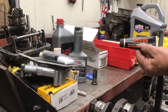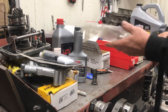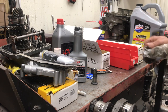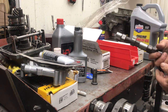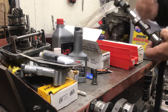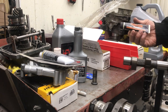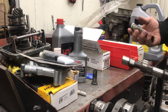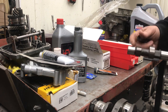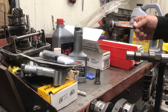Back in the old days you could get in trouble with cam lube, because what people would do is they'd pop the old cam out, take the new one out of the bag, and just lube it up everywhere — on the journals, on the lobes, on the bearings. Well, back in the old days cam lube had an abrasive in it. It was actually abrasive — a break-in abrasive to make the lifter mate to the lobe quicker. They had to take that out because people kept putting it on the bearing surfaces. So now it's different; there's no abrasive in it. It's just a high-pressure grease.